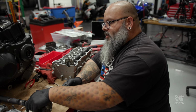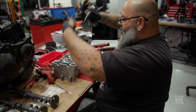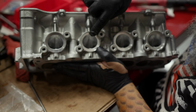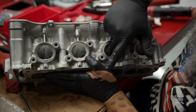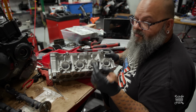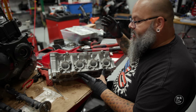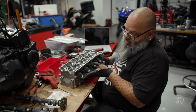That's in conjunction with what was done physically inside the cylinder head, which I'm going to show you in a second here. I can't just take this cam and flip it upside down because all the buckets and shims are installed, so I'm only going to give you about this much right here. If you could see inside, they have opened up these passages by grinding out some of the metal. They've ground away to a very specific shape and dimensions the passageways for the exhaust, which allows the bigger cams to do a better job of expelling exhaust gases out of the engine. They did the matching work to the intake side as well.